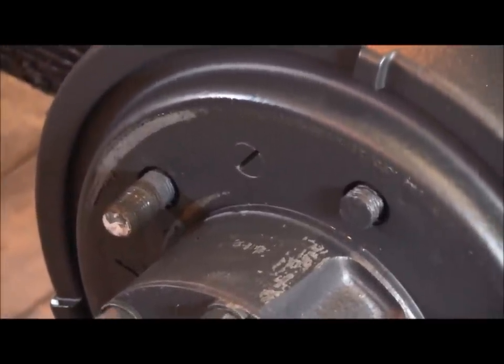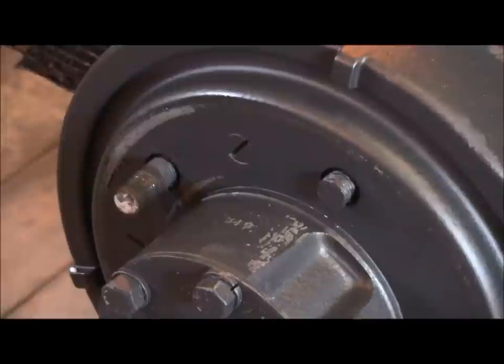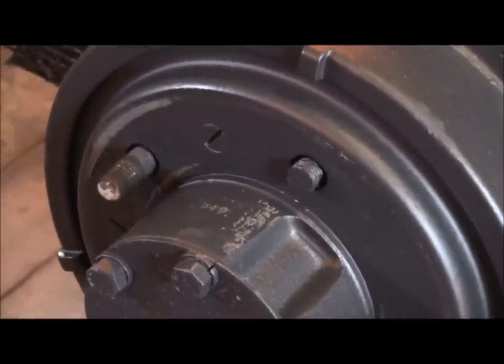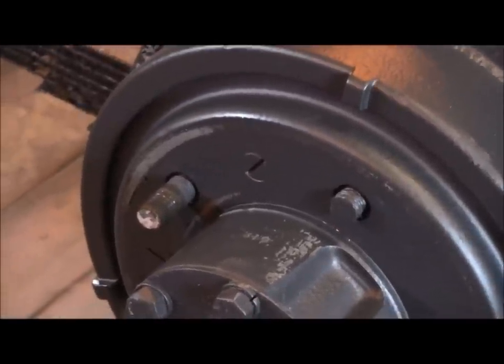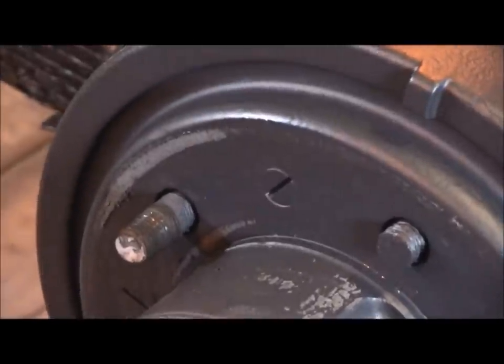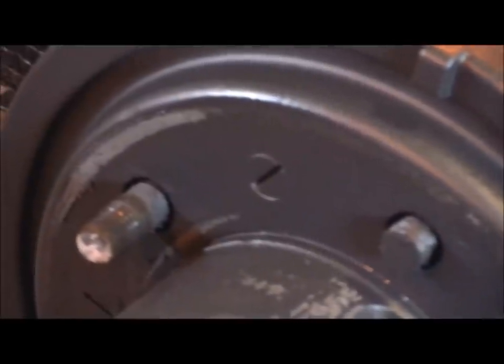One thing about left-hand lug nuts — even though they should be on the left side of the vehicle, the hubs are interchangeable. Over all the years of repair, it's not unusual to find somebody put the left-hand hub on the right-hand side of the vehicle, either on a Jeep or a trailer. Another issue with the M38A1 and the trailer that goes with it, the M100, is that the drums are held on by three little flat-head screws.